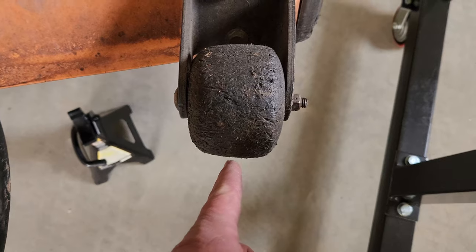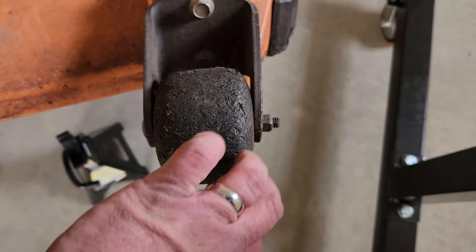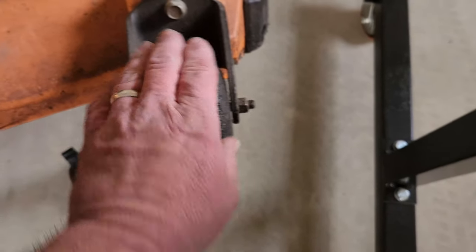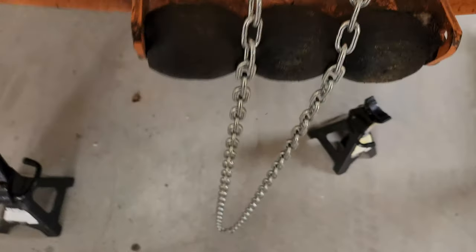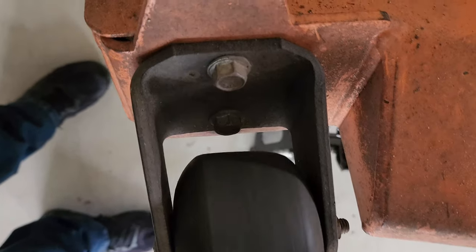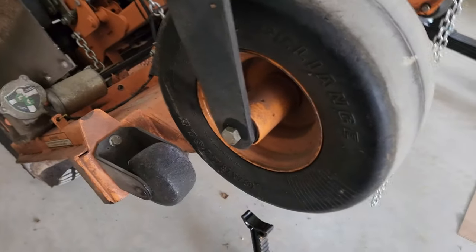Do you see how much thicker it is on the outside still? Well, I turned it around. It was wore on the outside, and the inside was real thick. So instead of just wearing out one side completely, I just take them off and turn them the other way. These are straight, but the outer ones, see how pronounced that is on the outside to the end? Because I rotate them. It's just what I do. You can do all of them like that. Save you some money.